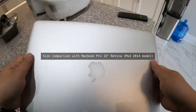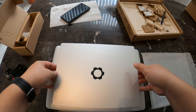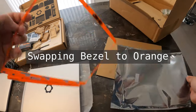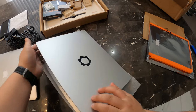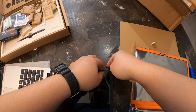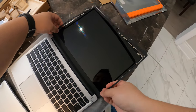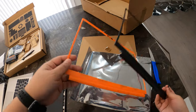For a size comparison, this is a 15-inch MacBook Pro from 2014 next to the Framework. The Framework is much lighter — probably half the weight. That orange bezel is very bright. To swap the bezel, you open the lid to 180 degrees, snap it off from the bottom, put in the orange bezel, and that looks pretty nice.